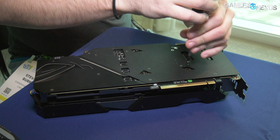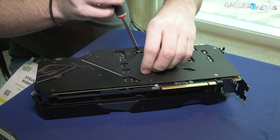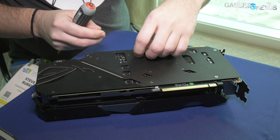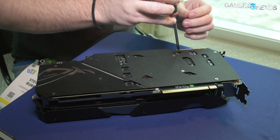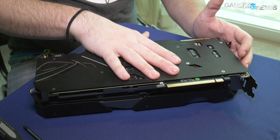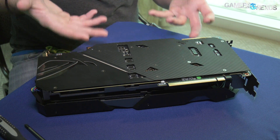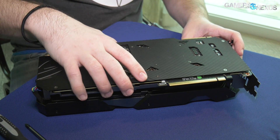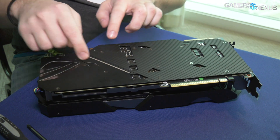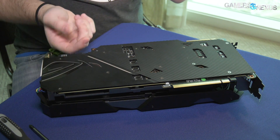It's wider — it's got a bigger diameter than all the others that you typically see on cards — and so even though this is water-cooled in a GPU with everything compacted into one shroud, they have done some pretty unique things to take care of thermals. If it's just like the Strix, it's four screws to loosen the entire cooling assembly, which is nice because there's a substructure under the shroud that is the structural support for everything, so it only needs four screws. All of these spots are an indication of a screw coming through the base plate, through the PCB, and then securing the back plate to the card.